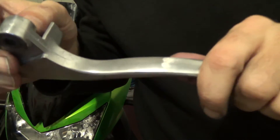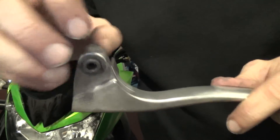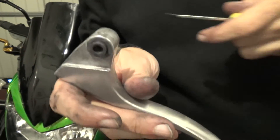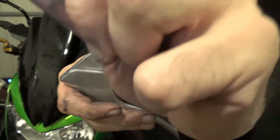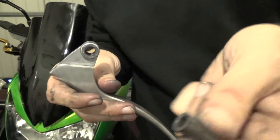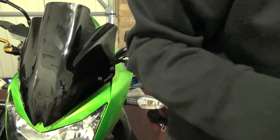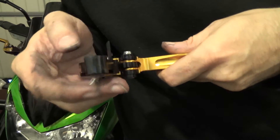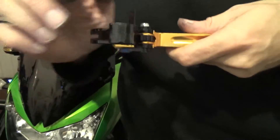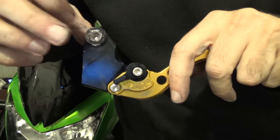Now then, the old lever has a metal bushing in the pivot which my new levers don't have. So I have to pop that out of there — that bit there — and that goes into the new lever. I've popped a bit of grease in there and it should just slide in nicely. Maybe I put a bit too much grease in there, but we'll have a bit back down the middle. Keep everything rust free.